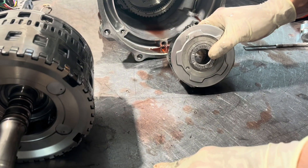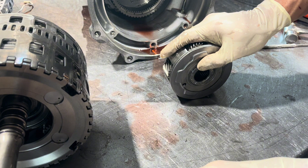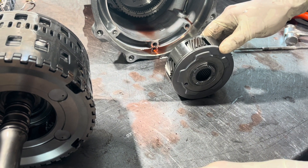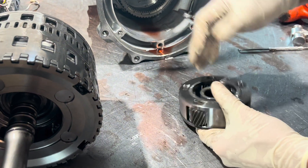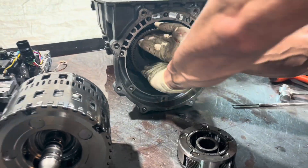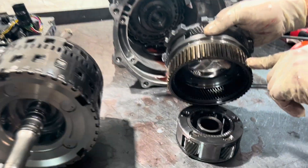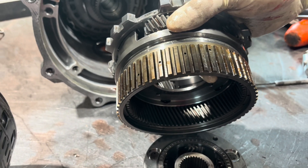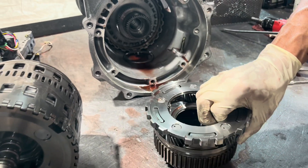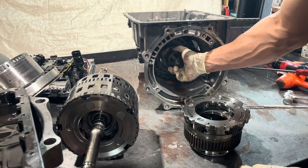These are a little different than some of the other versions — the RE5-R05A versus an R01A found in passenger cars. You're going to sometimes have steel planetaries instead of aluminum — it's got some stronger stuff. And we can see that this is black here, so they've got burnt clutches from one of the previous failures — one of the many previous failures.